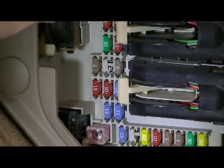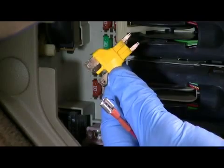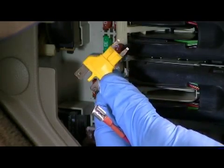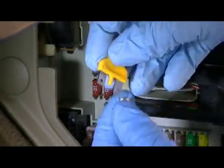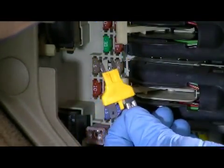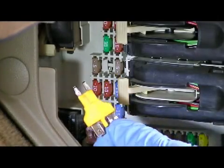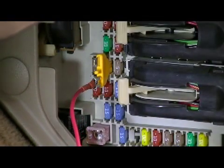Once I have removed the fuse, I need to insert the appropriate size fuse block adapter. You will notice there are two locations on the fuse block adapter I can connect the repowering rig to. One side will send power directly to the airbag control module — this is the load side of the fuse and is where I want to connect. The other side will send power into other areas of the vehicle's electrical system. This will not cause any damage to the vehicle, but noticeable indications can range from dash lights illuminating to the radio playing music.